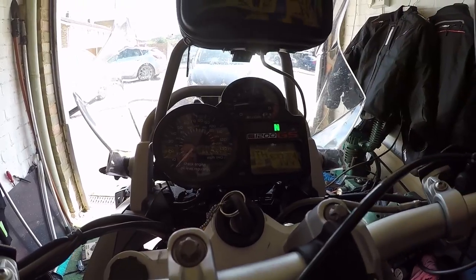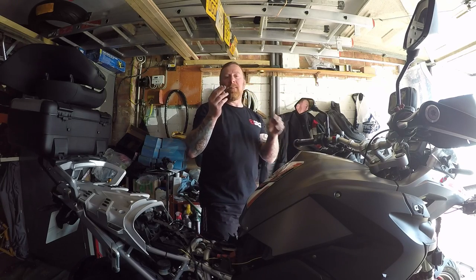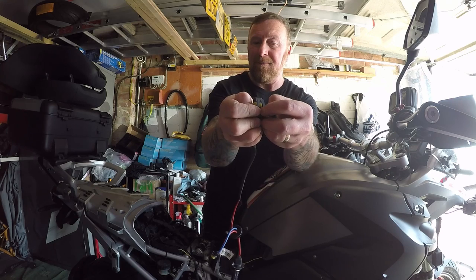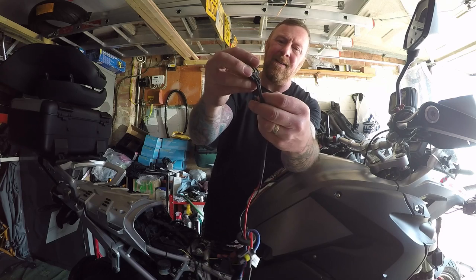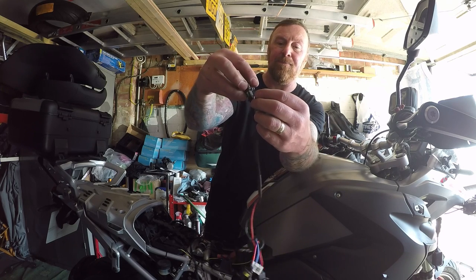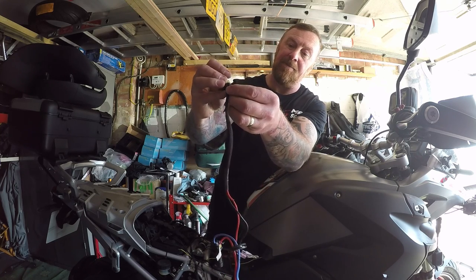Off we go — what a simple little fix. I thought it was 22mm, but I've fitted many of these in cars and found that the clip here is too big to get through with 22mm. The clip pops off but you still won't get it through at 22, so you've got to do it at 25mm. 25mm is perfect and it just clips back on — it's only for the clip bit anyway, not a biggie.